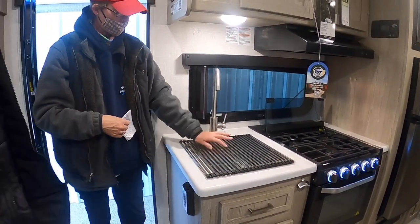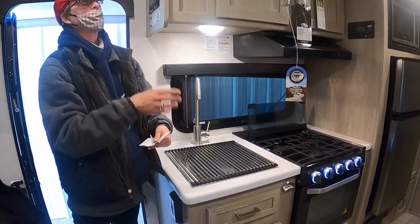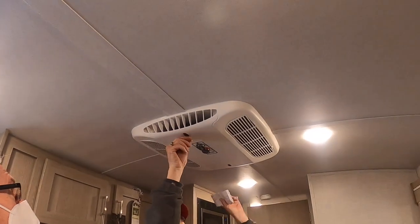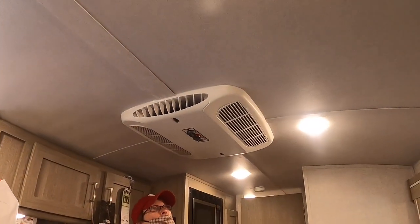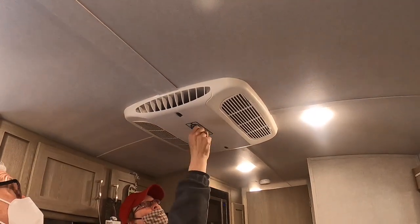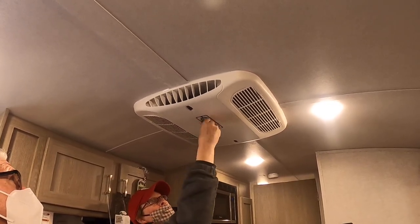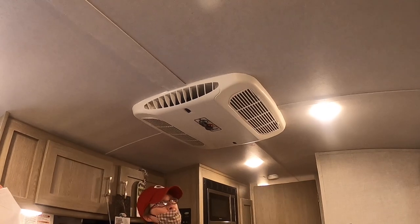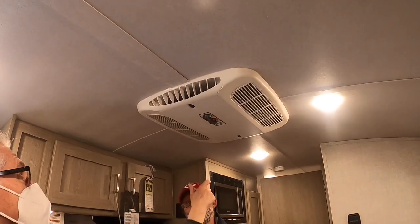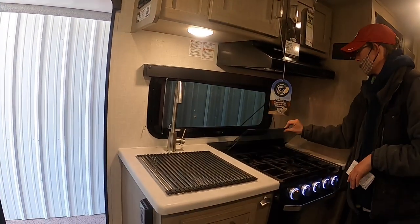Over your sink is a dry rack and outlet. Heat from the furnace comes out here, and your air conditioner output is up top — air comes out both sides, controlled by those dials. The intake is here with little filters you can wash with water. You can set it to fan only or cool, and adjust the temperature a bit — there's no heating element in the AC.